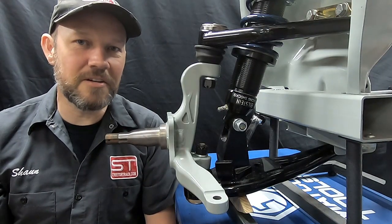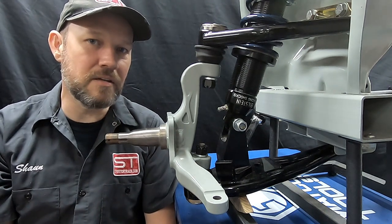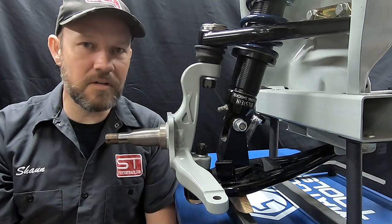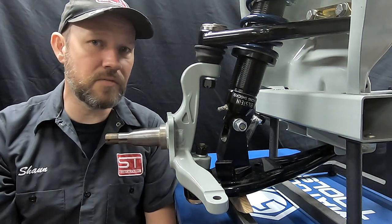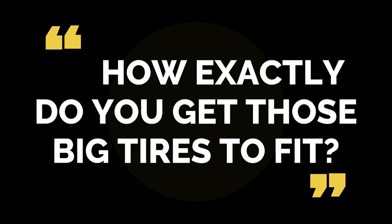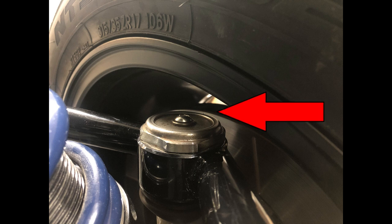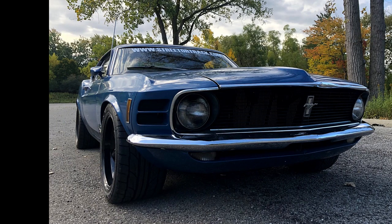I hope after learning a little bit more about this piece you're just as excited as we are. Let's go over a few more details. The bearing size we're using is the Timken set 12 and set 13 — the same as the '70-'73 Mustang — for added strength with wider tires. We're also using a beefed up steering connection, the same size as the '70-'73 Mustang outer tie rod end. The ball joints are the '65-'73 size. You can use the Moog ball joints that come standard in our coilover kit or upgrade to our high-precision CNC ones. What we've essentially created is a drop spindle that fits inside a 17 inch wheel — as you can clearly see, the ball joint is inside the wheel. That happens to be a 17 by 10.5 inch wide wheel with a 315-35-17 tire on the front of a 1970 Mustang with nothing more than our front coilover system and a rolled fender lip.